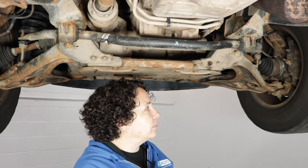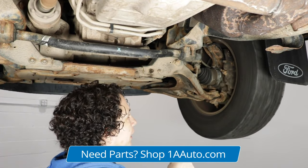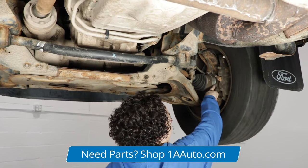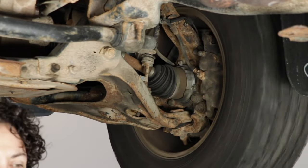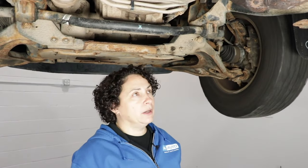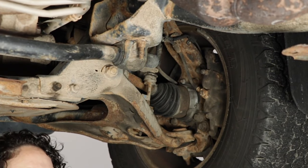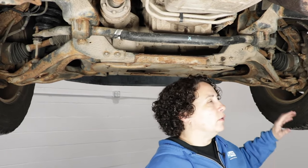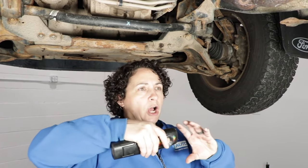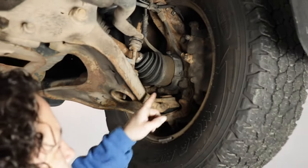What can make this intermittent? That hub not being able to come in and out will make this intermittent. I know I have vacuum because it's working right now. Here's my vacuum hub actuator — possibly faulty. It connects to the outside of that shaft, the CV shaft, and it has a nut that goes on it. Those are notorious for loosening up — even though you torque them, they loosen up. What we heard earlier was a growl noise out of this wheel, which is why I know the problem is over here. It sounded just like two gears trying to go together but not lining up. That noise tells me that this shaft is not engaged.